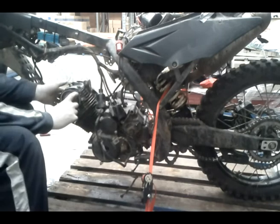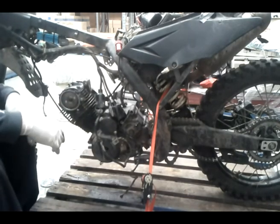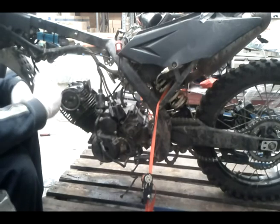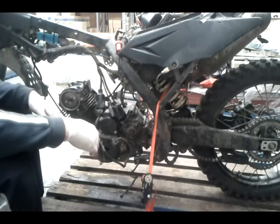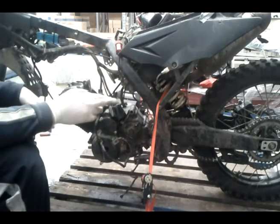What you want to do is put the case back on, slide it up, and then you're good to go. Turn it over by hand a few times, just to make sure the valves aren't hitting, just in case you did the timing belt wrong. Turn it on, don't actually give it power, have a good listen with the motor just kicking over, see if it sounds like anything's hitting or shouldn't be doing what it's doing, and then give it a crank over. Have your finger on the off button, just in case something goes wrong.